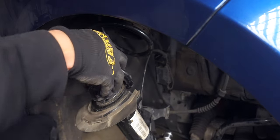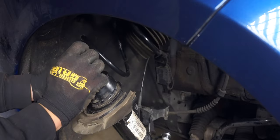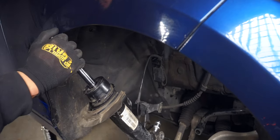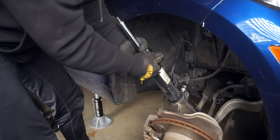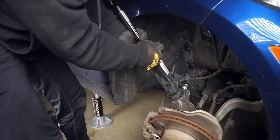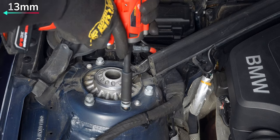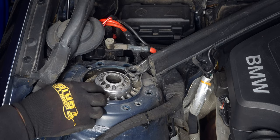All we need to do is lower down the piston so that we can tilt out the spring. By now, the PB Blaster should have had enough time to work its magic and make the strut removal a little easier. With xDrive cars, you should be able to angle it out as you pull on the strut. With the strut out, support the remaining assembly, and then remove the top half by loosening the 13mm bolts. Just make sure it doesn't fall as we will reuse this.